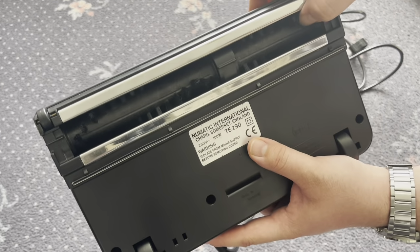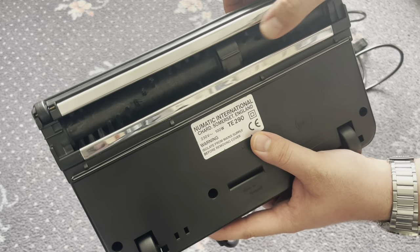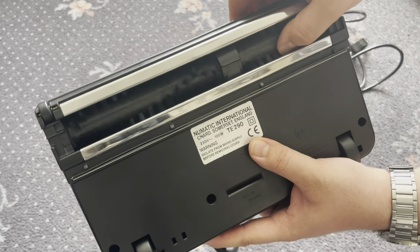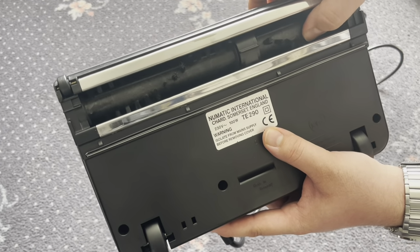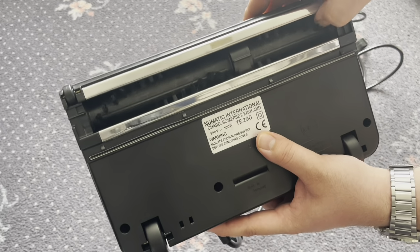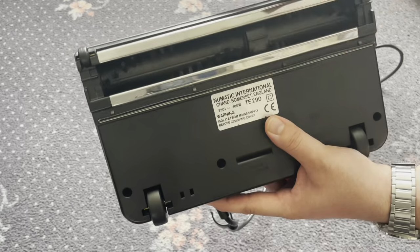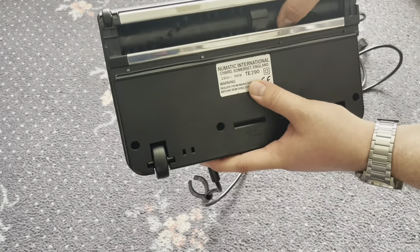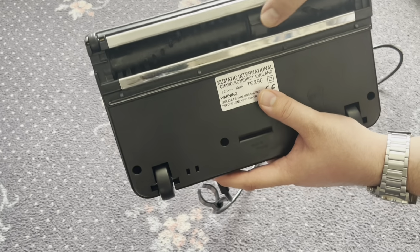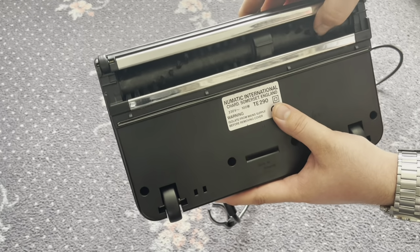It's got a decent brush roll on it. The bristles are quite close together, relatively soft. They're not overly soft, but they're not very stiff either. Plenty of them though, and they're sort of chevron design, so all the dirt gets swept into the suction path, which of course is in the middle. Belt is sort of in the centre. It takes a toothed belt, this one, so it should last for quite a while.